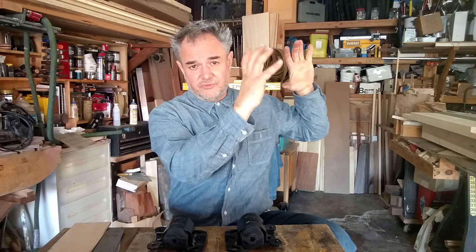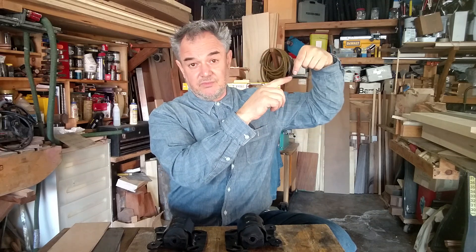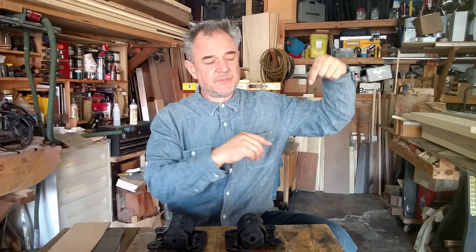I do a lot of my own work on the van but I brought it to Ronnie's Car Pros in Culver City — good guys I trust. We put the vehicle up on a lift and put a screw jack stand underneath the motor. Before lifting, I adjusted the fan blade so it was down low because the shroud is hard-mounted to the frame and the blade was nearly touching. When we lifted the motor it went from practically touching to where I can get over two fingers underneath the fan blade — clearly that motor can move, and it is moving with the crappy aftermarket engine mounts.